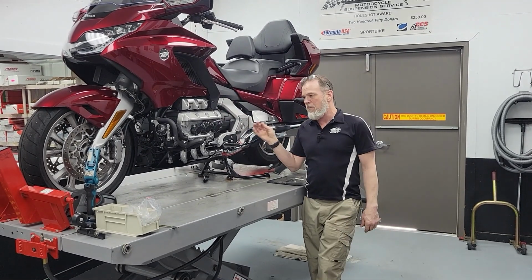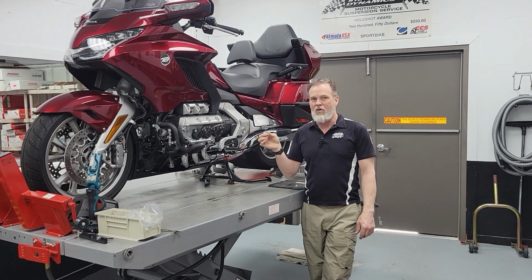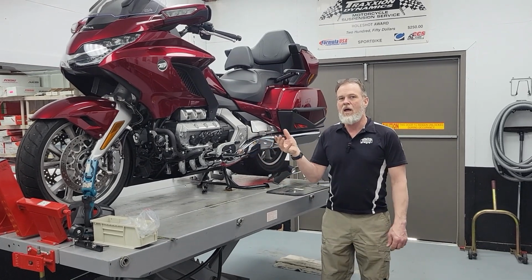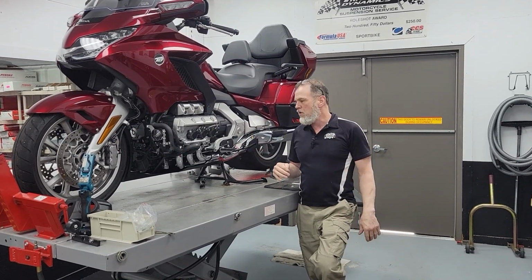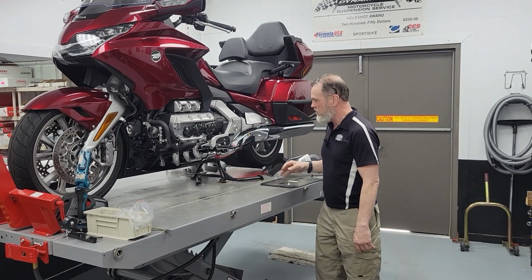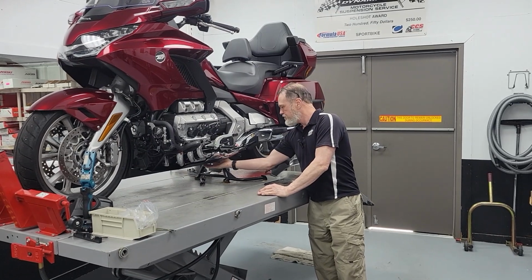That bolt, when you put it up in the hole and start to tighten it, you'll feel it swivel and toggle. It's really not seating on a proper surface inside. Then when you tighten the nut, you'll always see the washers all cone up into the hole. So it works, but it's not the ideal way to do that.